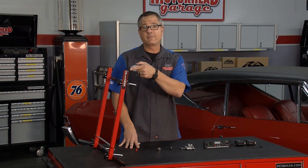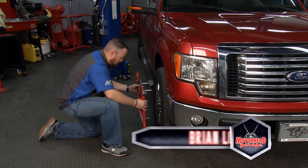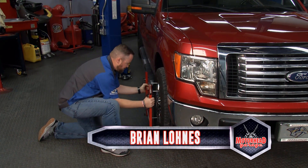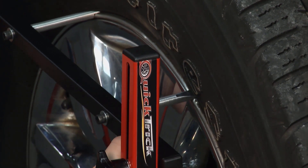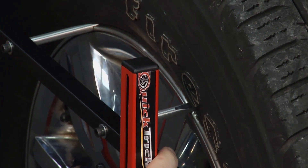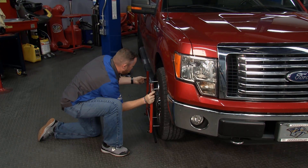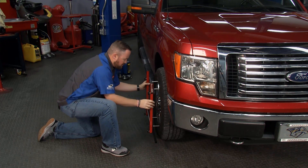We're going to put it to the test on an actual Ford F-150. One of our people here got it aligned and says it's perfect — we're going to check it and see if this thing works. While John gets his side set up, I'm going to get my side set. It's real easy. We just take our pins, set them into the little ridge — the bead where the tire mates to the wheel — and secure it down with the thumb screws. You want it squared up on the wheel, and as you'll see, it's got a nice solid bite.